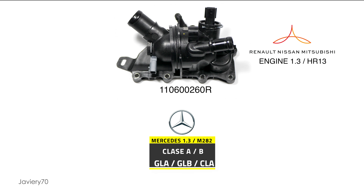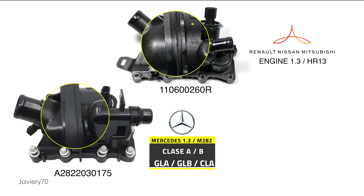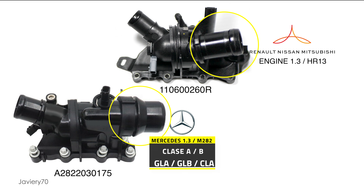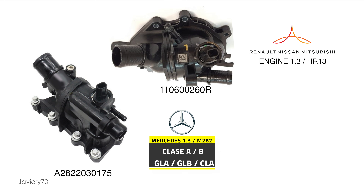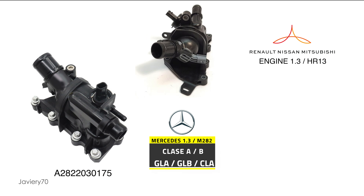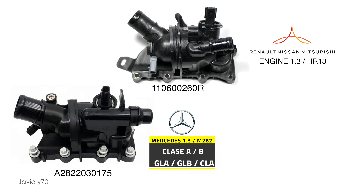The Mercedes brand, which also mounts this Renault engine, has the same thermostat box design, but the bonding and gluing is different. It has a better finished and more solid appearance, with construction and design in keeping with the Mercedes brand. The orientation of the hose sockets has changed slightly and the connection method is different — the small socket is attached by a click system and not by a clamp like Renault. Another difference is that the Mercedes does not have a drain plug but a small coolant outlet. The Renault thermostat box has a screwed bracket to hold a metal heating hose; the Mercedes one too, but it changes its location. By design, this Mercedes thermostat box has a more quality and solid appearance than the Renault one.